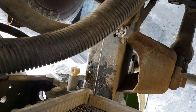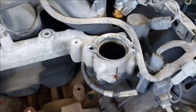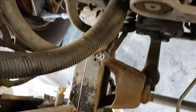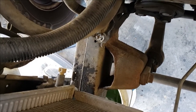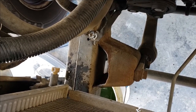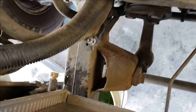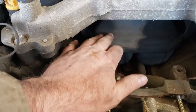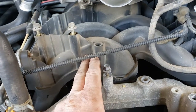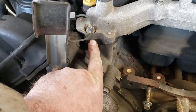It's still dripping some, so I'm just going to leave it. Got the top hose off, got the thermostat out. I'm going to let it drain as much as it can, because if you've ever spilled that stuff on nice concrete, it turns to a brown rusty-looking stain if you don't get it off immediately. You can see this is attached to the bottom of your intake — the intake is plastic, of course. This is the little bypass with the thermostat, and where these things typically go wrong is here and under here — the gasket under here.